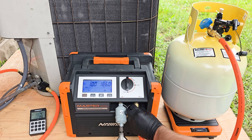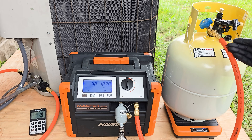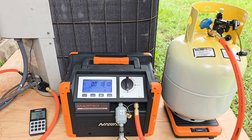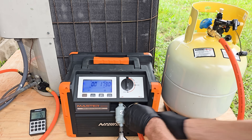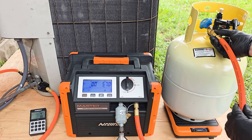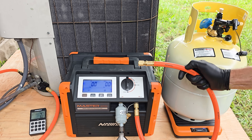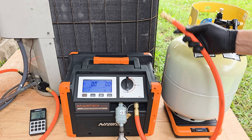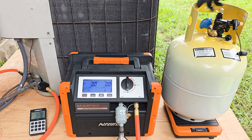The only thing that's going to have refrigerant in it now is this discharge hose right here. There's no way to recover the refrigerant in this section, so we're just going to have to purge that — make sure your handle is shut. Remember that at the end of your recovery process you just have vapor, so you do want to have a short hose, but you are going to have to open this up after you're done. After this is closed, we can go ahead and remove our T setup.